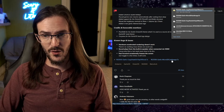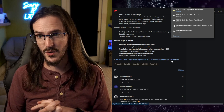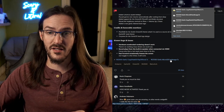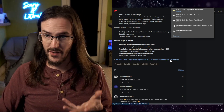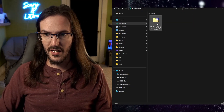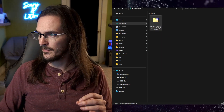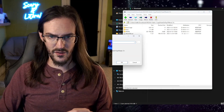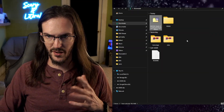The simplest thing is to click on the 'copy on top of stock' version and let that download. The other version is a straight-up disk image that you would use something like Win32 Disk Imager to flash onto the SD card — it's a clean slate, whereas this is just copying on top of what you already have. He also asks you to install 7-zip to unzip the file. Let's go to the Downloads folder — this is that zip file. We'll double-click it, open up 7-zip, and extract it. This does not take very long at all.